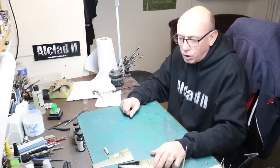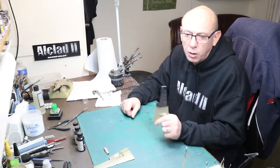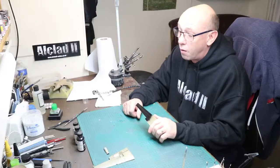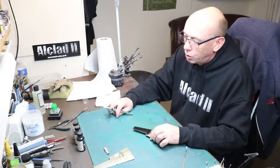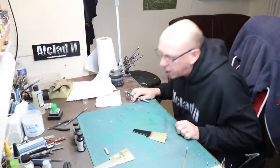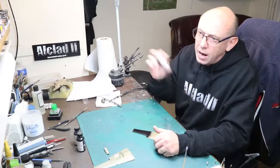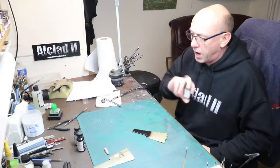Anyway, so we've got our gloss black base down. I was going to do some tonight, but I think time's going to be against us a little bit. If we get a chance, I'll lay a little bit of gloss black base down. But we'll see. Right, so the compressor is set to about 12 psi. You don't need any more. It's something you do not blast on. Now, the shinier the coat, the better quality your candy is going to be.